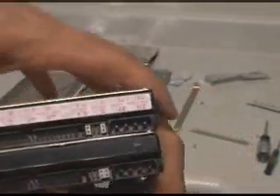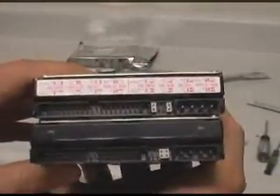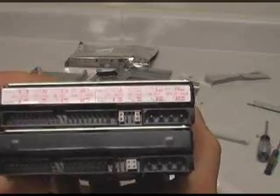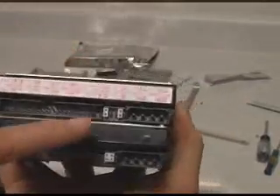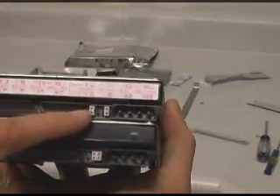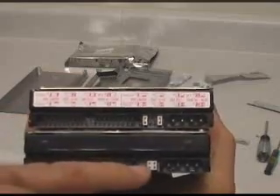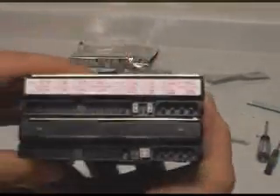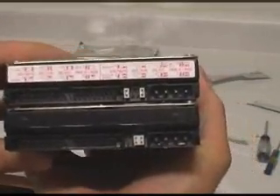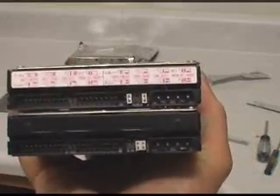Here's a shot of these two drives. Since they are IDE, to put them into a machine on the same cable, one has to be configured as a master device and one as a slave. With these Hitachi, formerly IBM drives, it's pretty easy to read the code and figure out what you want. The top one here is the master, the bottom one is the slave. They've changed the code and it isn't quite as easy to read, but it's still right on the drive. Some drives it's not as evident — you have to dig into some documentation. That must be done to get the IDE drives to function correctly with both of them on the same cable.